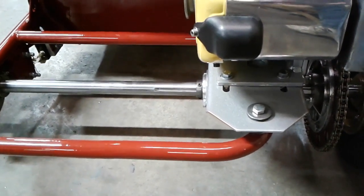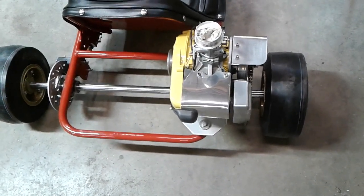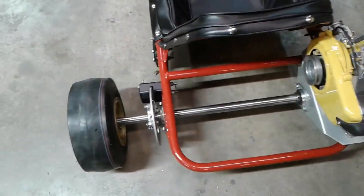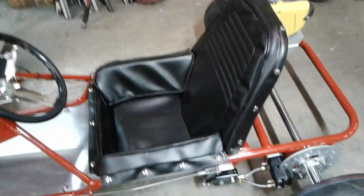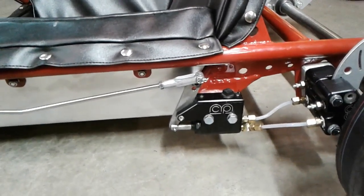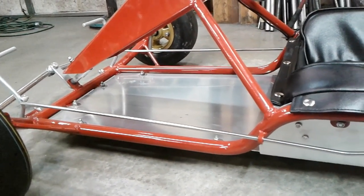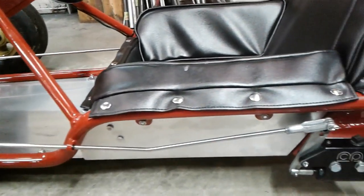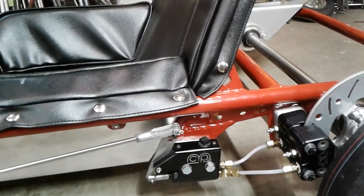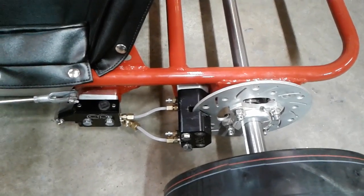These had a swing mount on them, mounted in the rear, not in the front. We kept the throttle and brake rod coming back through the chassis like they had them. At the tail end, I've changed them to make the rear brake assembly function, and upgraded the opposite side to a modern style system using compression fittings and heavy nylon tube, which is a major safety upgrade.